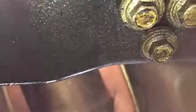And by looking at it a little bit more, it looks like I don't need to take the brace off, which is this right here. I can remove the 1 bolt that goes through and this here. So what I need to do now is get my jack and get it braced up on this, so when I go to remove it, the transmission doesn't drop. But this right here is the extension of the transmission I was talking about.